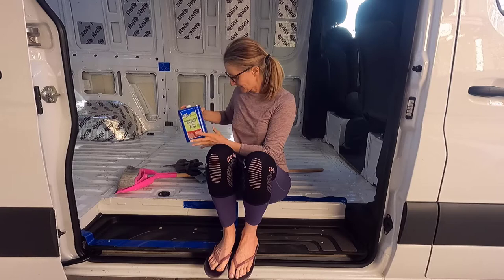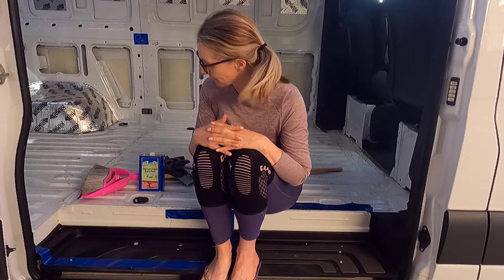That's really the first step I'm going to be doing this afternoon, and then tomorrow I'm going to go buy two by twos. I've really spent today mapping out the framing of the subfloor, so you'll see me do that next, and then I also need to create a template for the plywood that will go on top of the frame. I have some insulation material — granulated cork — and I'm still waiting on my Havelock wool order, so I'm probably going to do a temporary seal of the cork down as I need to do some traveling. I'll have that in place and then unmount it when the Havelock wool arrives to finish the insulation.